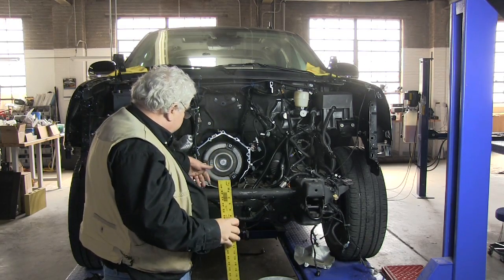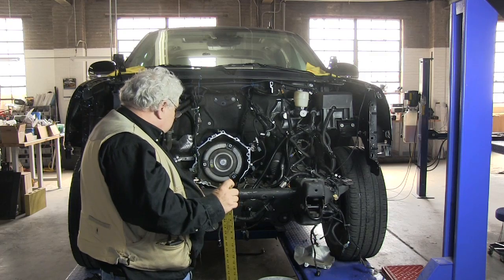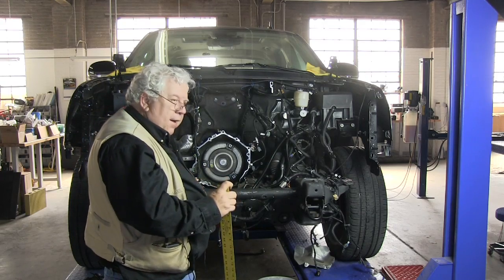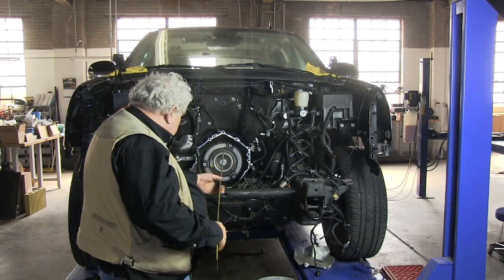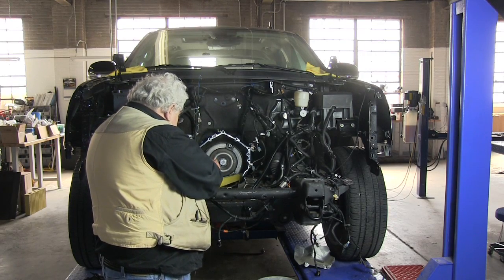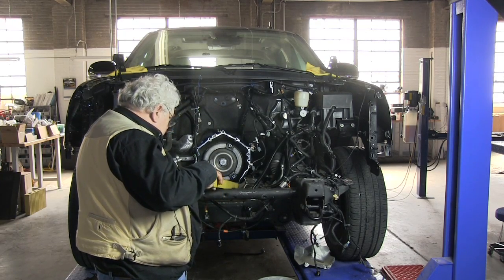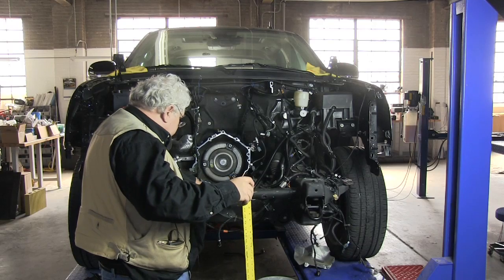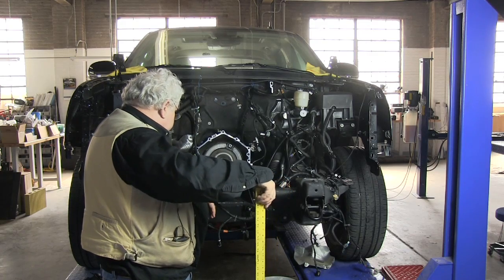Our radiator and so forth would normally be here. Now there were some fans to the inside of that we're going to have to lose, but the basic coolers and so forth up here, we're going to have more than adequate distance to accommodate the entire motor. The motor itself stands about 3 inches in from the edges of this, and so should clear everything. There is a little kink here in a line to our rack and pinion steering that could potentially pose our closest point to the motor, but I just don't think it's going to be a difficulty.